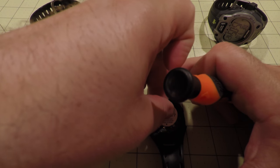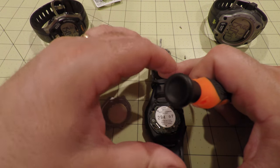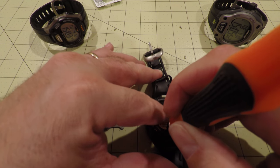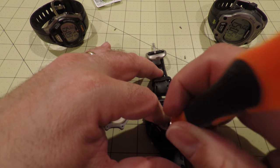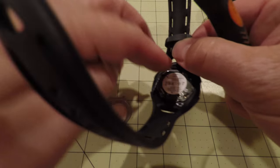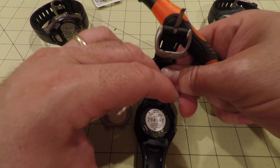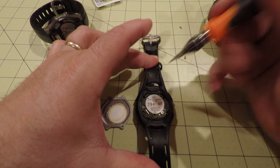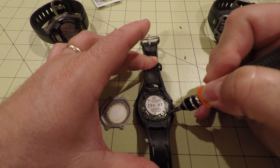Just because I'm a little OCD, I put the sticker back on — it's also a good reminder in case I need to replace the watch battery in the future. I then stick the same flat blade into the little hole that the arrow points to, to short it out and reset the watch. Before I put the back cover on, I check to make sure it's actually working. As I've learned from JerryRigEverything, before you put the cover on, make sure everything works.